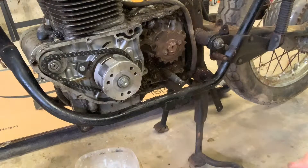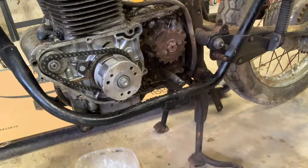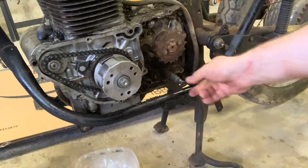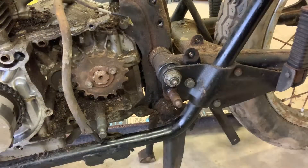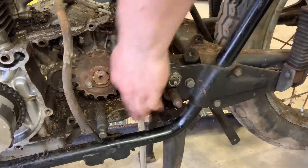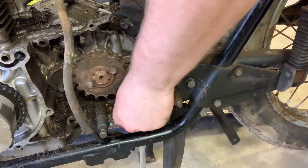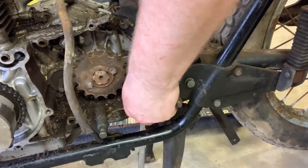In order to get these things going, grab your 14mm. It's going to work better to get your wrench behind this one. There is a small hold on the starter cable — you can just pull this, it bends kind of out of the way. Now that starter cable is free and out of your way. So here's our culprit. Drop that on there and go in reverse mode — works good with an extension, you can get right around it. This breaks right free. We're just going to pull this off, wait until that nut falls on the other side. It's a really long bolt — it doesn't have to come out all the way.